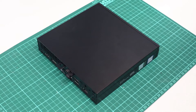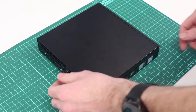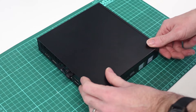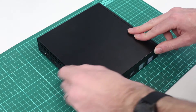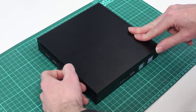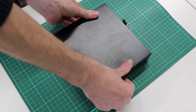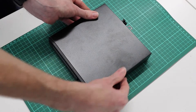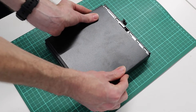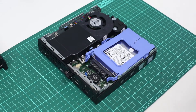Hi, I'm James and in this video we are taking a very quick look at how to upgrade a Dell Optiplex 3070 micro system. The first thing we need to do is undo the small thumb screw at the back — this is all that's holding the case on. We then slide the top of the case and the front panel forward. Make sure you've got any front USB connectors removed as they will stop you moving it.